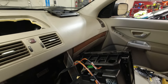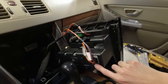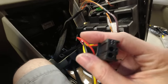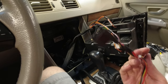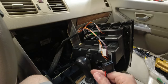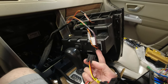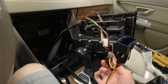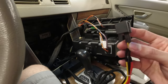Based on what I've been able to see so far, this harness with the gray connectors does not have the optical piggyback, which this one with the dark green connectors does. So that would be this piece here, these two. So what this is gonna do, I believe, is piggyback through this gate connector. So this here, there's an optical connector within this that will separate, and we will run that into this new connector, and this one will plug into the old connector, I think.